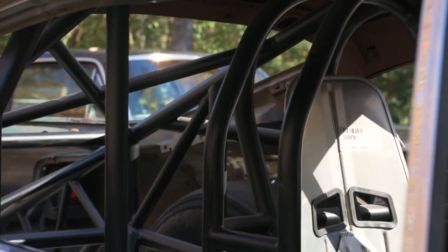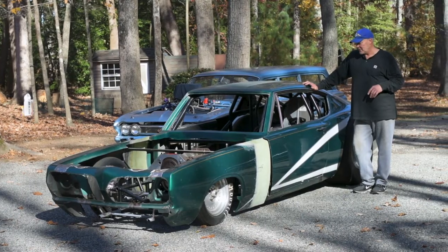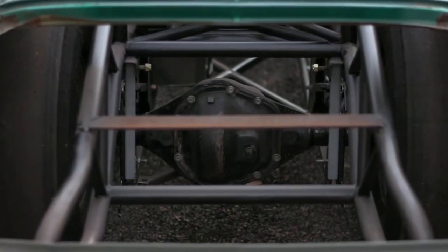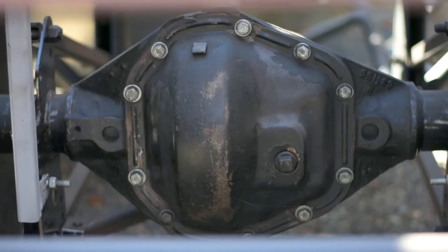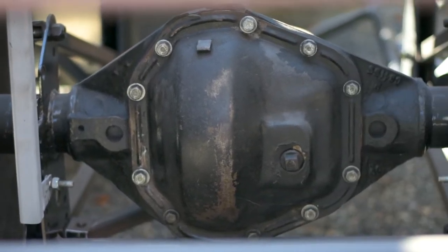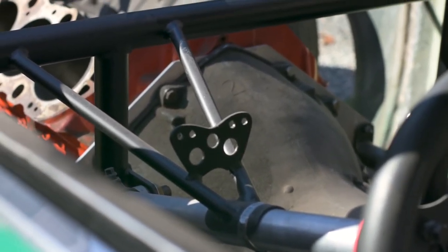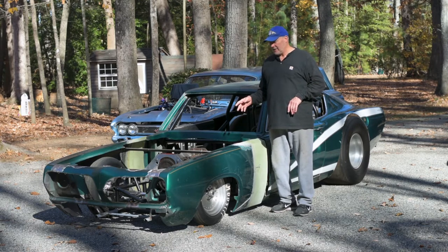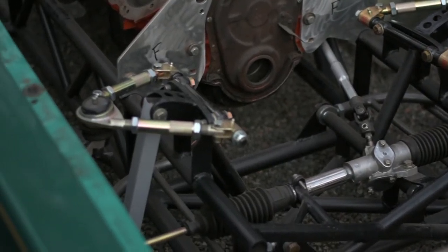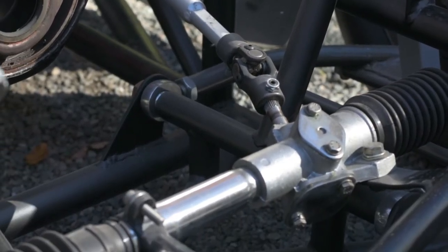The rear that's in it now I took out of the blue car. When I had the rear in the blue car it had really big tires — it's like a 38-inch rear. I had to get it out, cut all the brackets off, and put new brackets in. It's got four link in the back. All the suspension and tubing is hand bent. Every piece of the steering column is made, every bar is cut. The front suspension is Mustang 2 geometry — I made the lower control arms off a set of ladder bars from when I bought the car, cut them apart to make the lower control arm. It's got a rack and pinion.